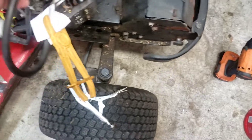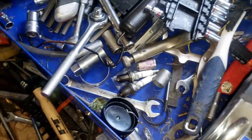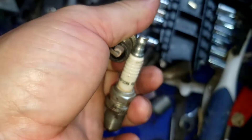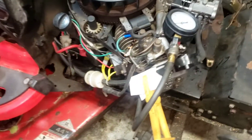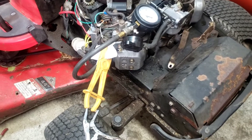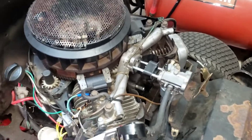No compression on that side, and I didn't pull the valve cover yet. I'm going to give you a call in a minute. One of the big indicators for me after I started messing around with it was that one spark plug had a little bit of carbon on it, the other one was oily and greasy and a lot colder than the other side. So I'm going to call you and ask what you want to do, and then we'll go from there. I learned something from older guys like that.